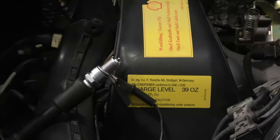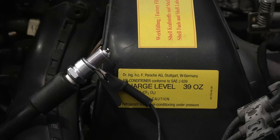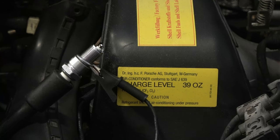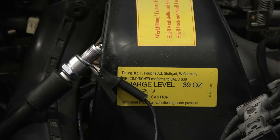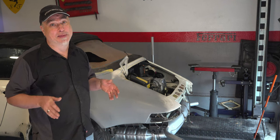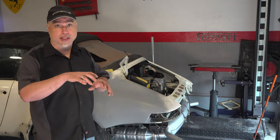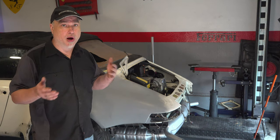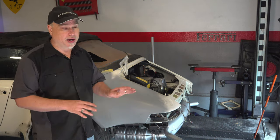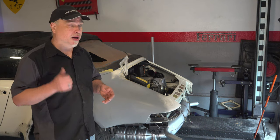I suspect I'm not getting any spark, so I'm going to run the starter. I need you to tell me if there's spark crossing that gap — the spark plug. I can see it sparking. I took some time to look at this and I think I got a little bit closer. Found out the distributor cap wasn't seated quite correctly, and I wasn't receiving signals from the alarm module, which I think was probably keeping the whole thing up — it wouldn't shut off. So I'm going to have to go in there and delete that. I got the correct signals to the ECU now.